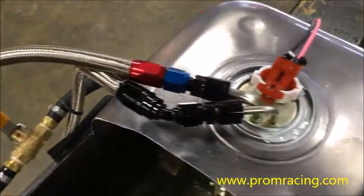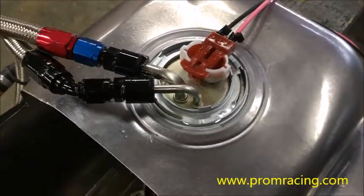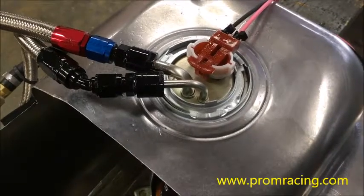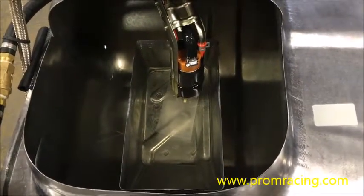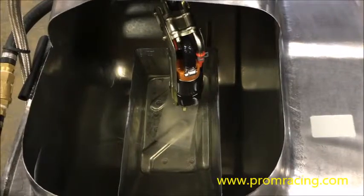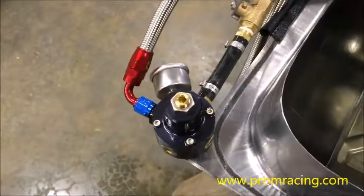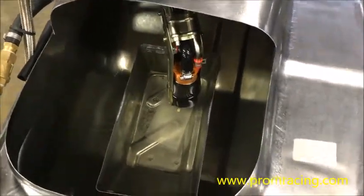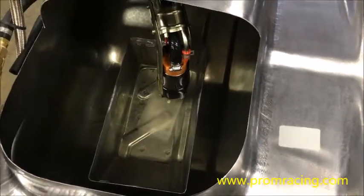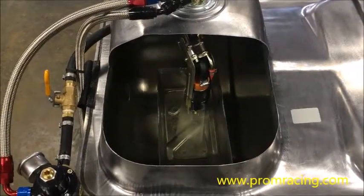We have the hanger connected to the fuel pressure regulator with 6 AN line and certainly both the line and the regulator are up to the task. But when the return line in the hanger becomes a restriction, it in effect becomes the regulator and the regulator can no longer do its job. You saw the needle bouncing — that's because the fuel pump is picking up air bubbles and it's causing it to cavitate, which is going to make the fuel pressure fluctuate. You will have to tune around all of these things if you use the stock Mustang hanger. Your fuel pump is still cavitating and you're still getting air bubbles into your engine, so your fuel injectors are now going to be spraying a mixture of air and fuel rather than straight fuel, and this is going to create a lean condition.